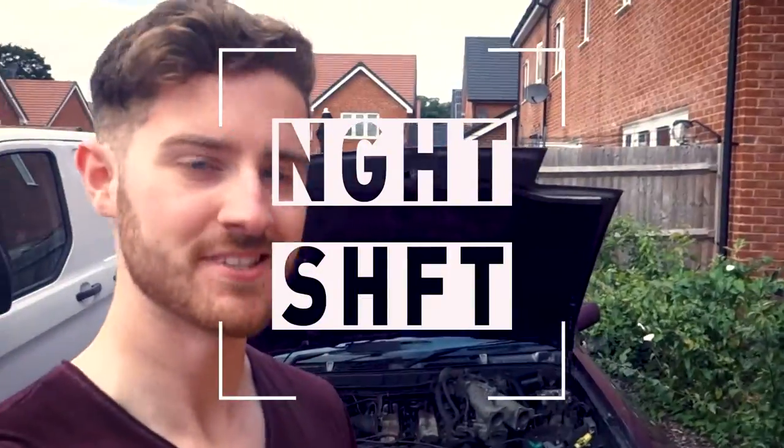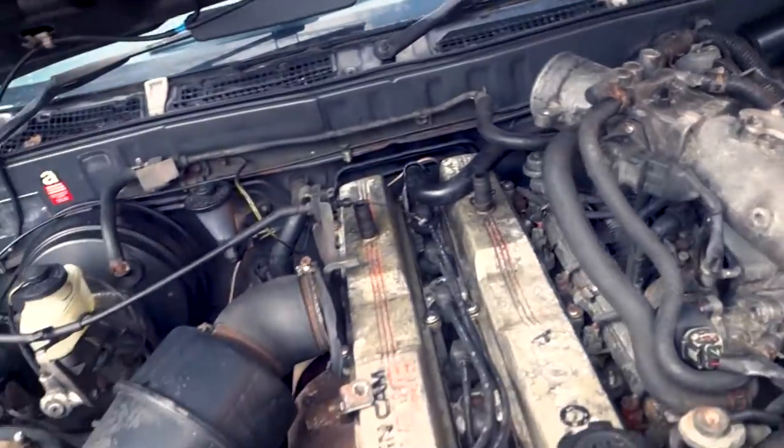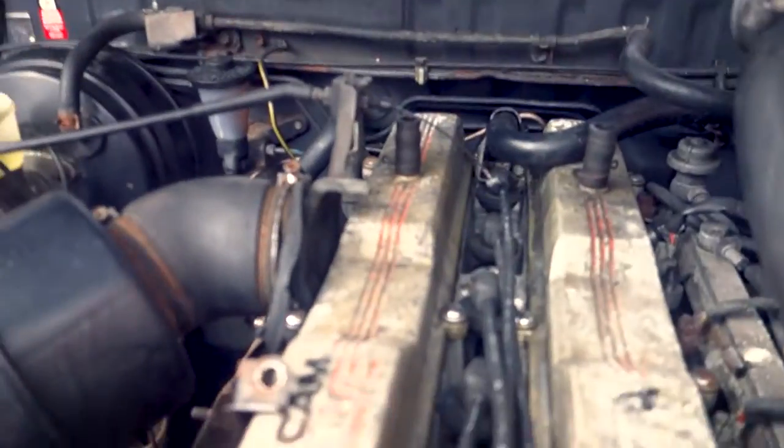What is going on guys? Today we're going to be fixing pretty much everything that I currently have going on with the Supra. As you can see I've already taken the throttle body apart yet again. Since we last had the car started, the car's developed a misfire. So I figured, even though there are pretty new spark plugs in there, they're going to need replacing — why not go all out and replace the HT leads as well.